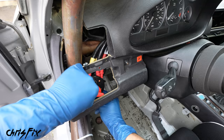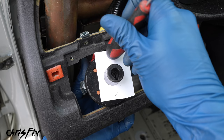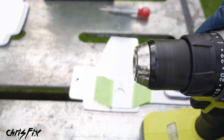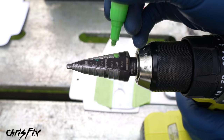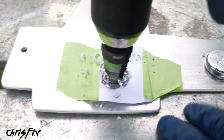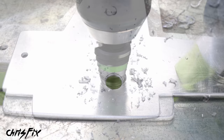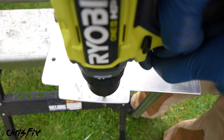Take the template and place it over our bracket, then use a center punch to mark where we need to drill. Then drill out both holes. With both holes drilled, let's go test fit this in the car. Let's thread in a bolt on this side — good — and let's try threading in the other side as well. Both sides threaded in straight and now our bracket is secured in place. Now let's unscrew this because we need to make a template to cut the switch holes out. The main hole is a 7/8-inch hole, but we need to get the location of the smaller holes that mount the switch to the bracket. So get this on here and use the back of a screwdriver to make indents in our cardstock — and that's where the holes will go. Now let's get the bracket back in and tape up both sides of the template where we want the switch to be. Now let's cut the holes. So first, center punch the main hole for the switch. Since we need to drill a large 7/8-inch hole, let's use a step drill bit — a helpful trick is to mark the bit with a bright color like green right on the 7/8-inch step. Once this color disappears, you know you're done drilling. Get the bit centered on that center punch hole and start drilling.